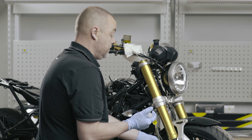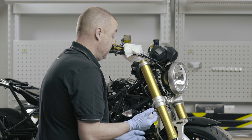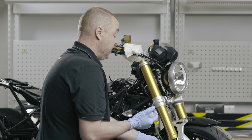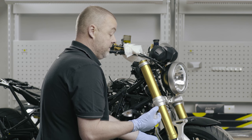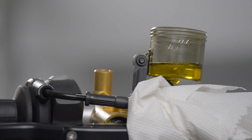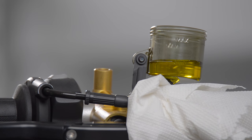If I exert too much pressure with the syringe, it's possible that one of my connections will release and spray the brake with brake fluid, which is always a bad idea. If that happens, just use copious amounts of water. Brake fluid is hygroscopic and as a result it attracts water.